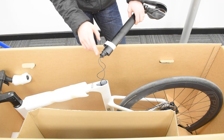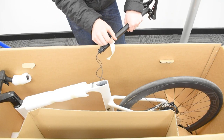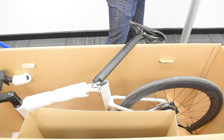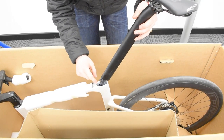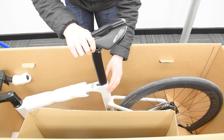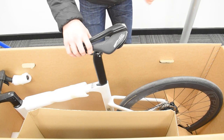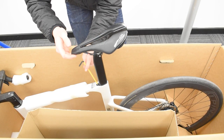Now that your battery is firmly lodged in your seat post, take the tape off from around the clamp and make sure that's fully removed. Your next step is going to be to slowly feed the wires into the seat tube, and the saddle and seat post will follow — just to a rough height for now. Get your seat clamp, ensuring all bits of tape have been removed, and slide it into its little slot. Then get your 5mm allen key and tighten that up.